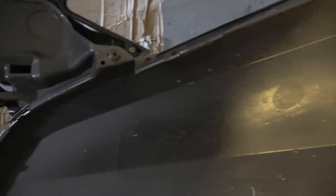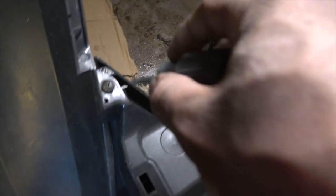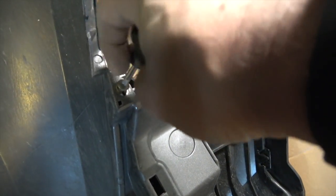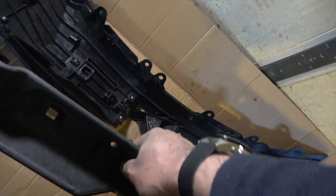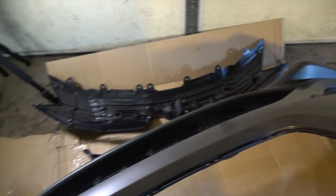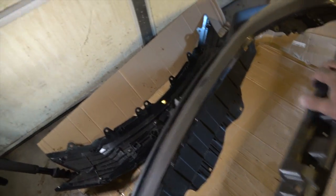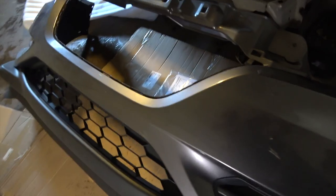So that's what it looks like with the bumper completely off. You have to unclip it and there are some screws right here behind where the grille sits. Just take off these screws and then the grille should come right off. I removed that bolt and that screw, and there it goes. That bird did some damage, but let's see what it looks like without the grille — everything looks okay.